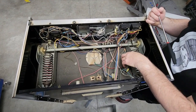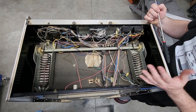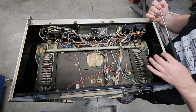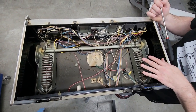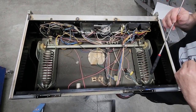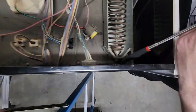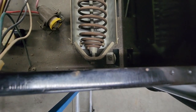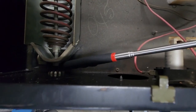This will give you a better view of the 1962, which is a little simpler than the 1960. Almost everything is visible in the 30-inch, and in the later years until '64, '65, they didn't get too complex. These are the spring trays here. Back behind here are the bolts we talked about for the spring pressure, which controls the raising and lowering tension of your oven door. There's one right here as well — that bolt.